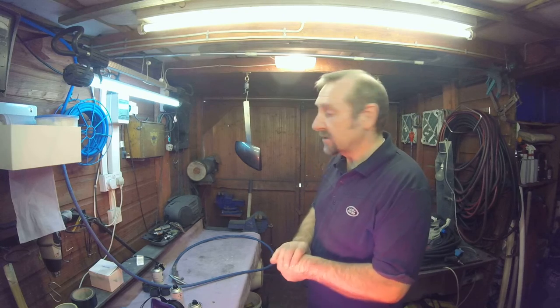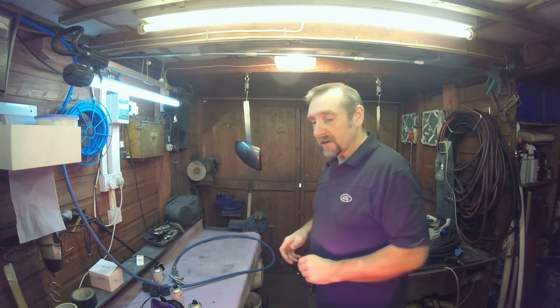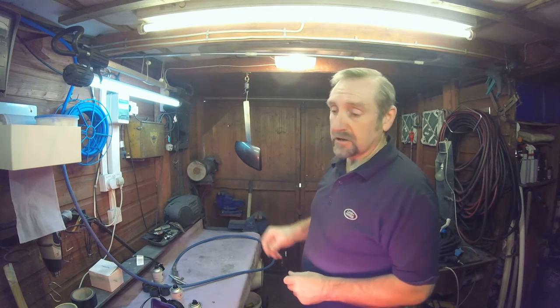Once you've got the second coat in, there's ample paint on there then to protect the part from UV rays so that the paint doesn't fade and go dull in years to come. Right, that's part two. I'll turn the fan off, go and set up for my clear lacquer, and be back to you guys as soon as I can. Keep watching.